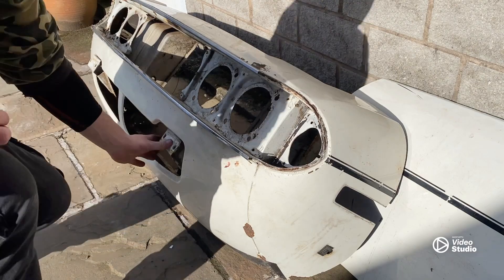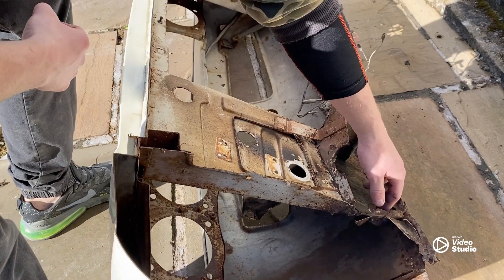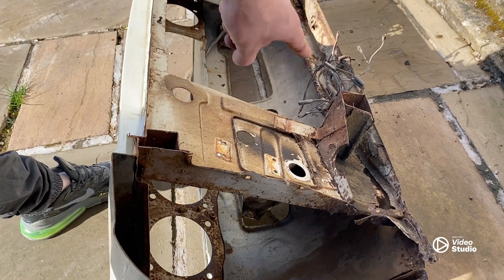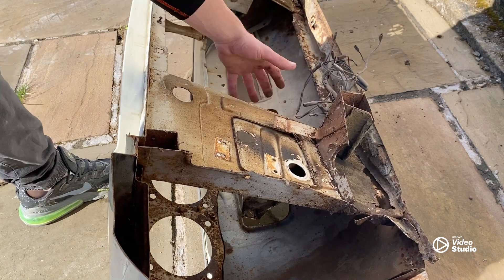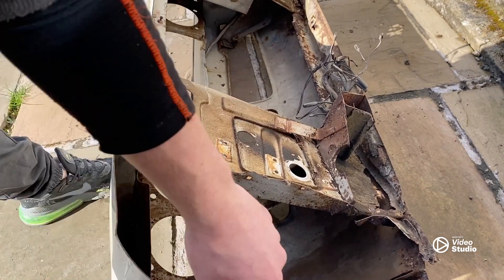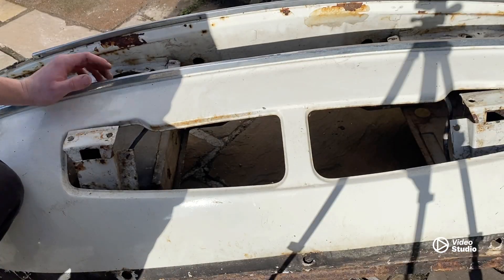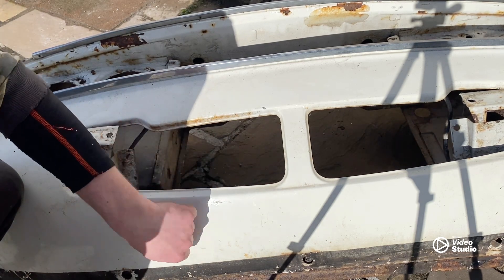I'll just have to take the grinder out and clean up a few bits here and there. There is a bit of rust I'll show you that needs repairing on the back of it. This inner support panel here is just where the rust is — that's just going to need a little bit of fabrication on the bottom end. The plan is to chop out these two front bumper mounts from this panel, then my old bumper mounts should just slide through and I'll joggle this edge in around onto the original front end of my car. Overall I don't think it's too bad — no filler in it, it's a solid honest panel.